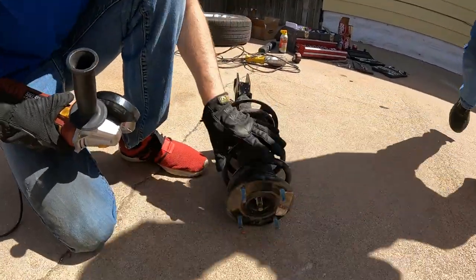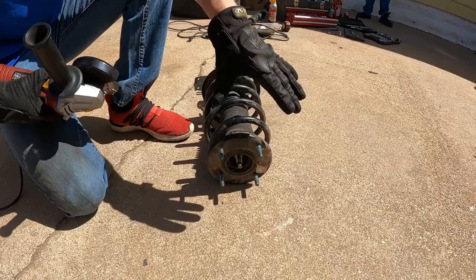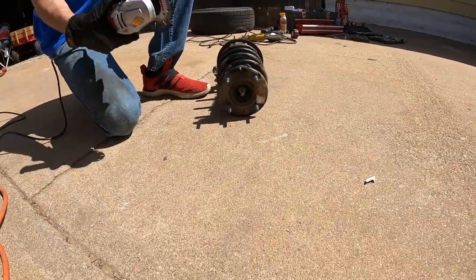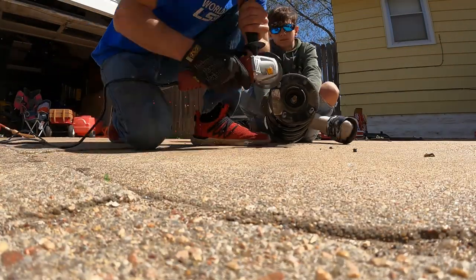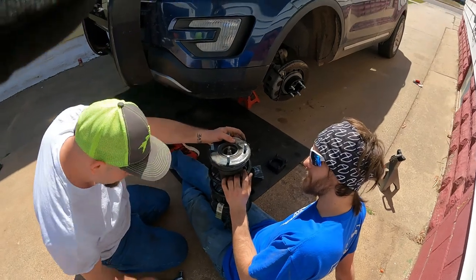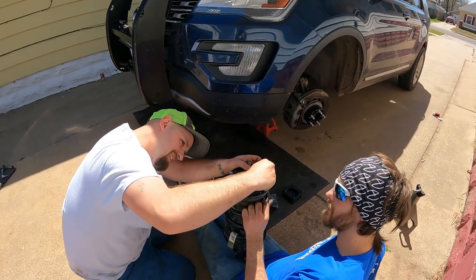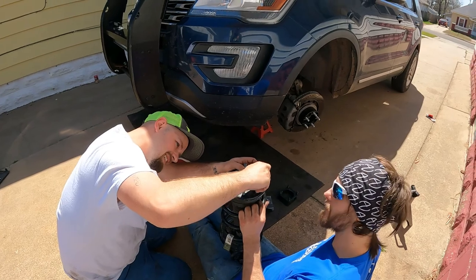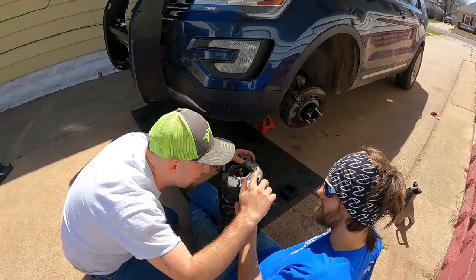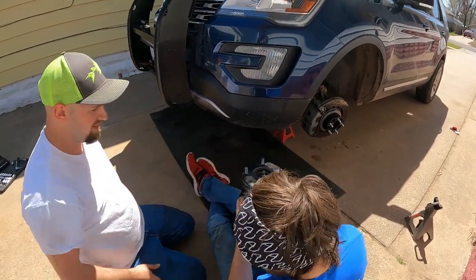What we've got now is we need to cut a quarter inch off of each of these bolts so that the bracket will fit on here and we can get the nuts on. I've got an angle grinder and I'm going to go ahead and cut these ends. Now that we've got all these ends trimmed, we've got to file them down a little bit to get the nut over it. Before we put the mount on we're making sure we can bolt it on — I had to notch a thread here where it was screwing up.